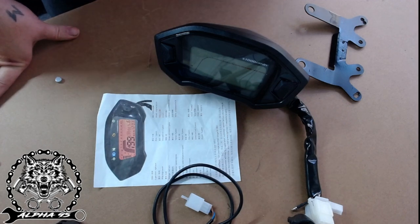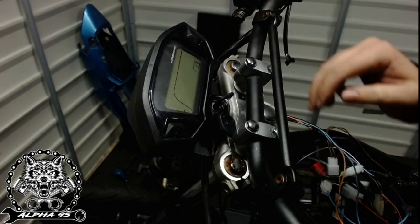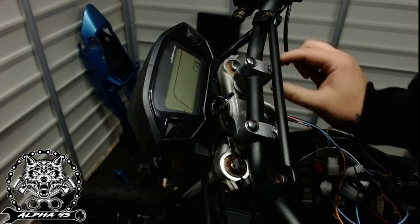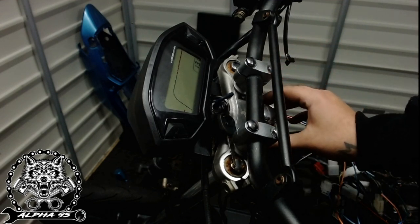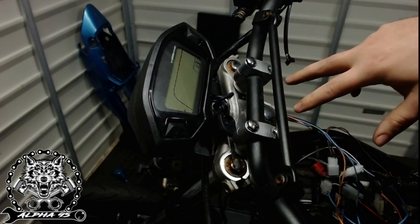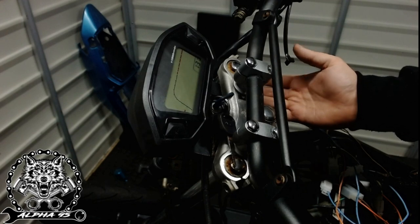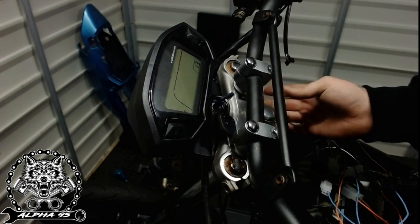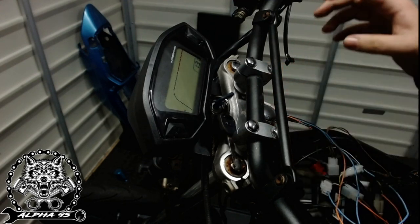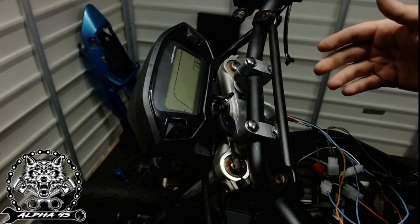So with that, let's get started. Over to the bike - we've now got this fixed on with our modified bracket, and what we've got under here are the bolts coming off these two clamps. This entire top yoke is getting changed very soon before it goes in for an MOT, because the previous owner who did this conversion drilled two holes but not only didn't fill in the bottom of the yoke - which I'd recommend you do as they're not designed for this type of stress - but they've also not done them straight. So I'm waiting to order a new yoke to sort that out.